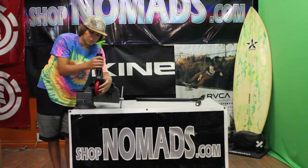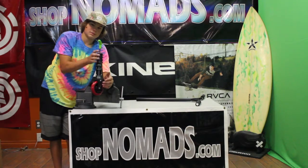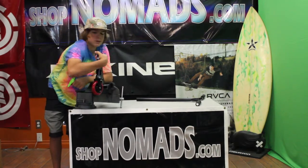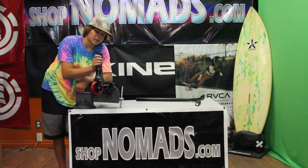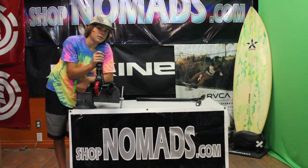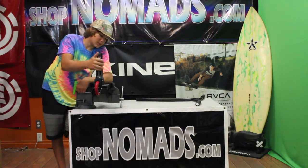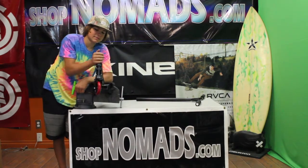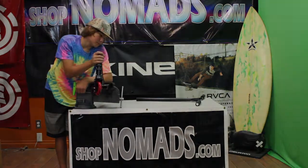Once it's tight, you want to tighten it to a point where it'll spin about half a rotation on its own. So it's spinning about half of one. And you don't want it to wobble. So you don't want it so loose that it's wobbling, but you don't want it so tight that it doesn't spin. So just find a spot where it spins freely about half a rotation.